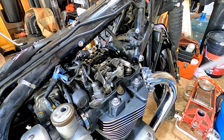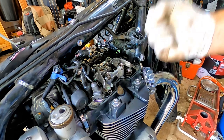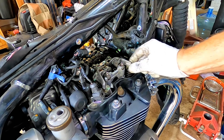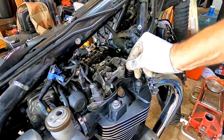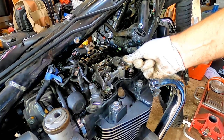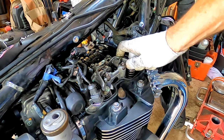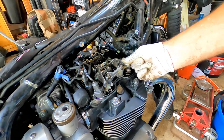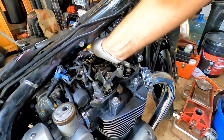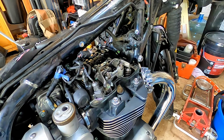And that's the critical ones, right? The exhaust valve seats will tend to pound into the head and it will decrease the gap on the rocker arm. Generally these will tighten up with time, and if they get too tight the valve doesn't close all the way and it burns. So if you can go to the top side of the spec — which I think we are, about .18 — the spec is .18 and we're between .15 and .20. I think we're really good on the exhaust valve.